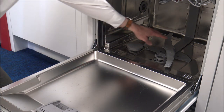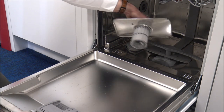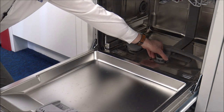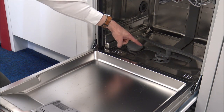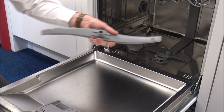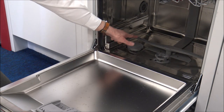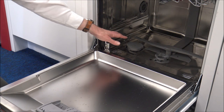When it comes to cleaning and maintenance of the dishwasher, it's really easy. First of all, you've got the filters just at the back. This is quite a standard kind of filter for the Neff, Bosch and Siemens dishwashers. That just pops in there, and once you've cleaned it, it just drops back into that section. You've got the spray head which just pulls out, so that's nice and easy to keep clean. Salt is really important to fill - just make sure you use proper dishwasher salt, don't use table salt.